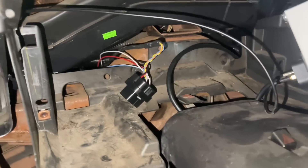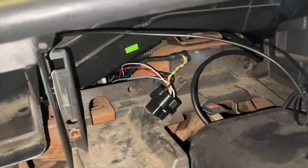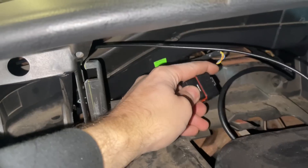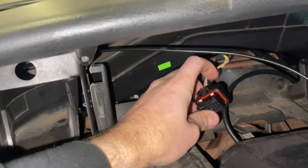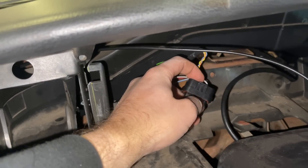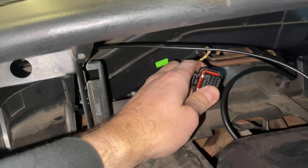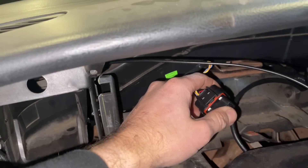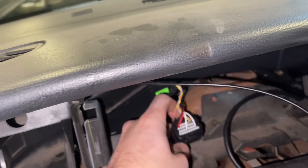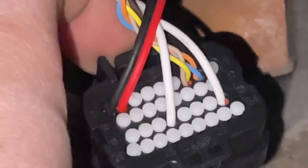There's the connector we needed. This is our main power and CAN connector for the Prodash. We reach in here — there's a little white tab. You've got two tabs on both sides of this thing. Two tabs here, one tab here. You press on the single tab and this side is going to pop up. Otherwise it'll be flush. Push that sucker in and then come over to the back here and pop out our corresponding plug that we need.